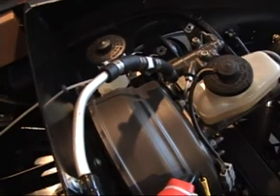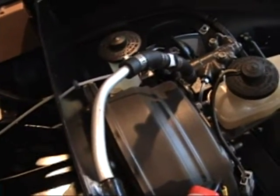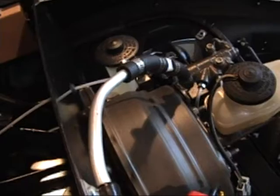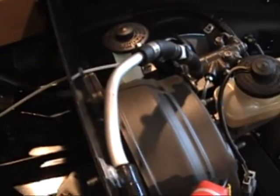Everything's tied down tight — everything but the air conditioner. The air conditioner is just going to be left for now. My three gauges are wired up. The boost gauge is coming off this little tiny white wire here that goes up and ties into the power brake booster. My boost gauge only shows boost and does not show vacuum, so there's a check valve here in the booster cylinder that will allow this to be only a boost line when there's boost in the motor.